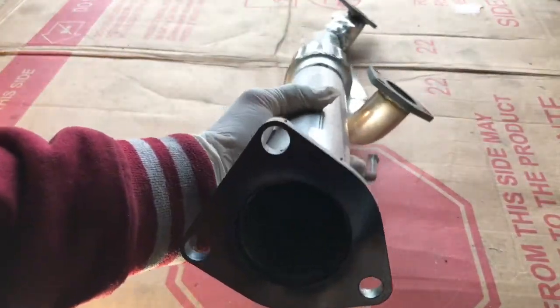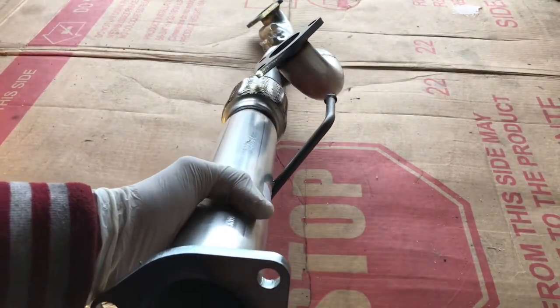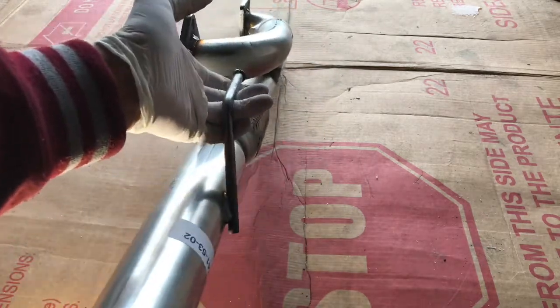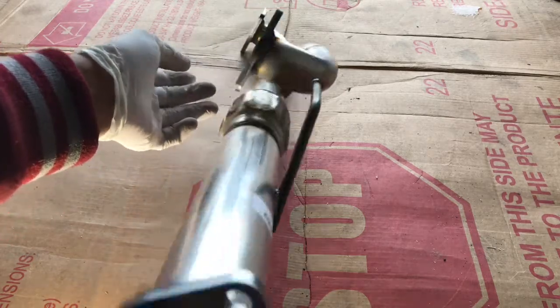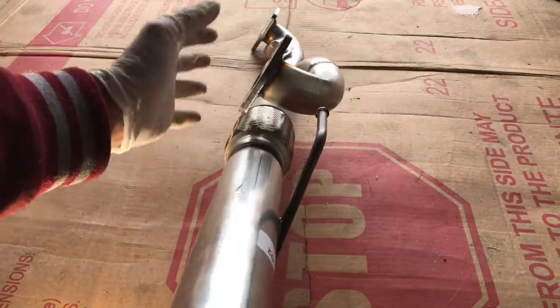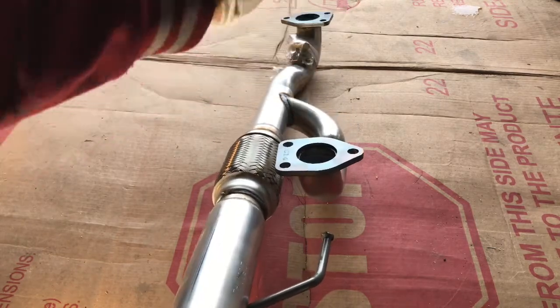It's not that expensive. The reason this happens most of the time is a split because the hanger is supposed to hang like this. Most of the time this hanger is no longer holding, the hanger is broke. So this thing is all the time moving like this, and it's attached to the body — I mean the exhaust manifold.